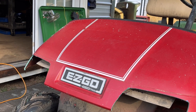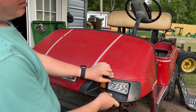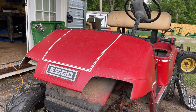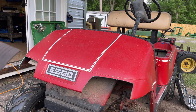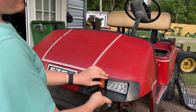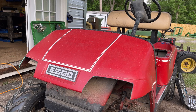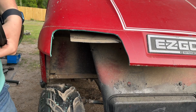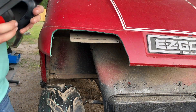Let's see if the lights fit. Yeah, that's a good fit, that fits just fine. The only thing I had to do was take an angle grinder and cut out this little plastic cover underneath, because the bulb assembly of the headlight was hitting that cover. I just had to notch that out so it would fit, and once I did that the headlight fit right in. I'll keep the video going while I cut the other side — you can see here how we're hitting up against that plastic shield, so I'm just going to round off that edge just like we did the first side.